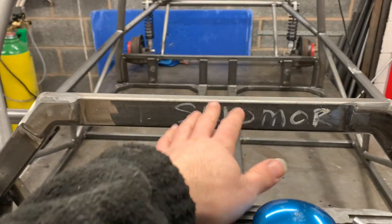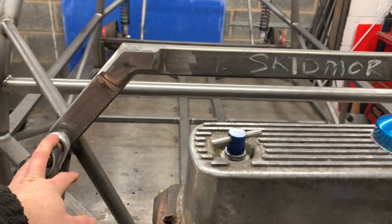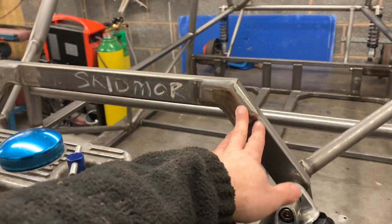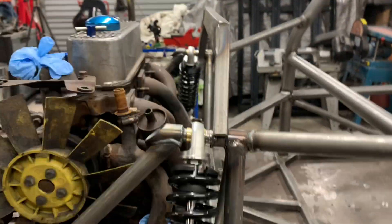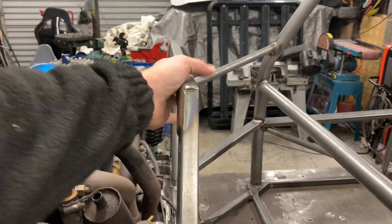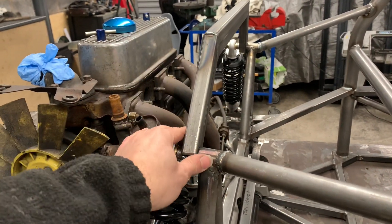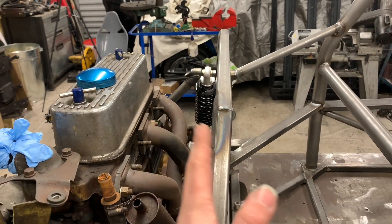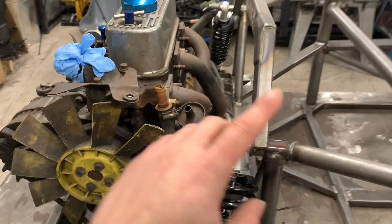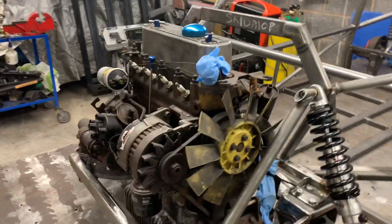We've got this support here which goes to the top - it helps stop any deflection. And this is the up-and-over. The job with this is to support the bonnet. Where we've welded it pretty solid, it's got gussets here just to give a bit more shape. Inside the end it's spaced out so it can't squash. That's pretty solid - it's not welded in yet. I'm leaving it up to the new owner. I set it back a bit more so the engine can literally come past it without having to remove it, and it's such a tight tolerance it's therefore part of the structure of the car.